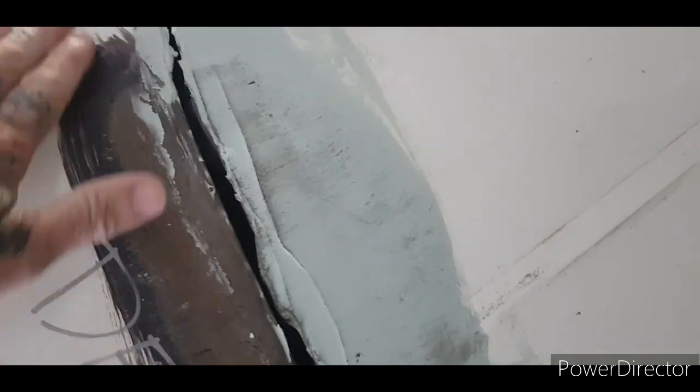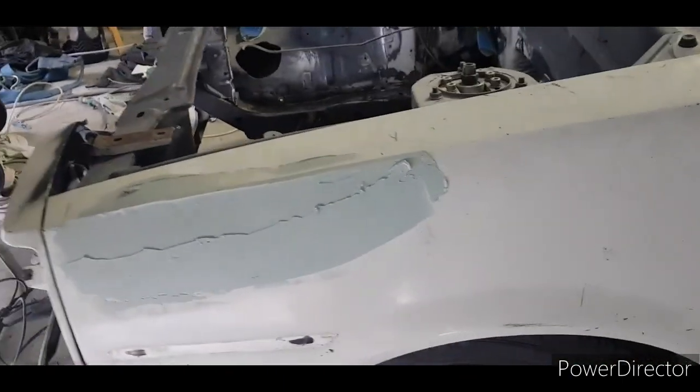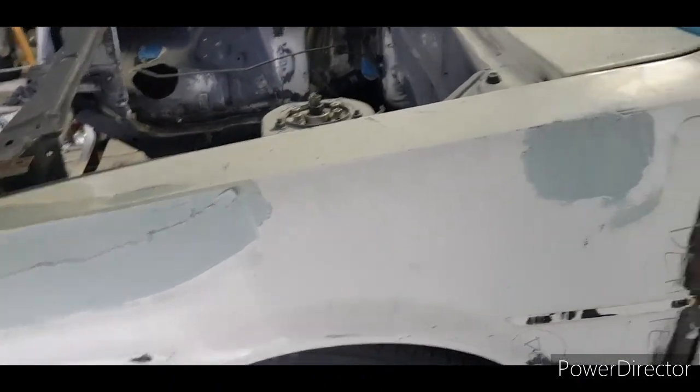But yeah, basically, you open the door and you put something in there. I used the rubber mat and wedged it in there and then started hammering it. Kind of folded it out, smashed it in places. It probably needs a bit more of a bead in, because it's actually bulged out. I don't want it too proud from that, but it's actually quite solid. And these guards are like paper. It's funny, if you work on Mazdas over the years, the guard's actually quite non-flexible, but because it's the original, it's real, real flexy. The other one was way worse. Everything you did just folded it out.